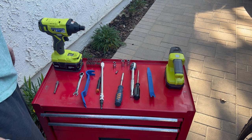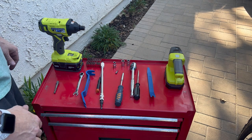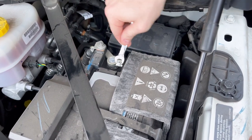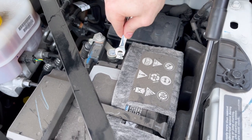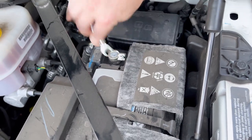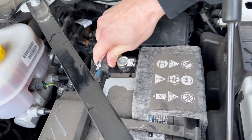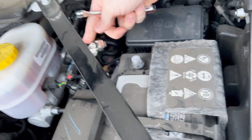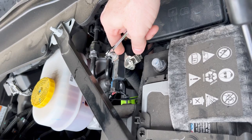These are pretty generalized tools that most individuals will already have in their garage. The first step is to take off your negative battery terminal. The instructions say this because newer cars hold memory a bit longer, and you want no power going when removing any electrical connectors. Loosen and remove the negative terminal, then let it sit for at least an hour. If you can put it out of the way, go ahead; if not, put a rubber glove on it so it doesn't reconnect.